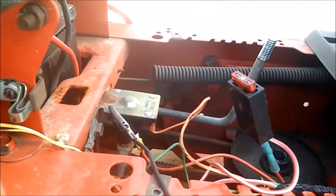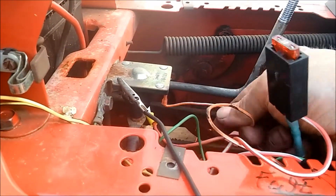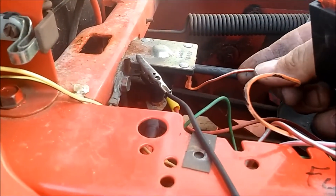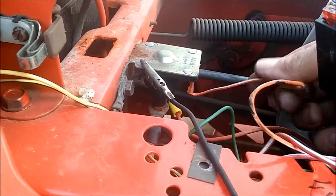This one here — what you're going to do is get a 12-volt light bulb tester or light bulb, and you're going to put the tester in there and see if you've got power out. If you don't get power, now you're going to have to do some troubleshooting. This is orange with white.